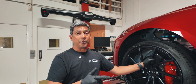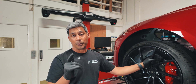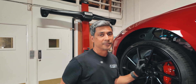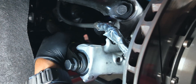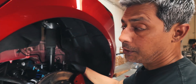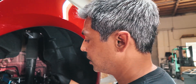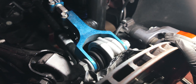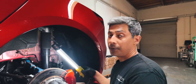Now we're going to pop the rear wheel off and show you guys what's going on with the toe arms back there. We already changed the camber arm, so we can't really show you that, but I'll pull it from the box. Right here in the knuckle — you see that bearing? This is the toe arm. This was not a bearing on the older platform, and I do not believe it is a bearing on the Long Range Highland or rear-wheel drive or any other trim of Highland — I believe those are rubber bushings. However, the camber arm location was a bearing on the older platform, and they kept that on the Highland Performance. But on the other trims of Highland — long range, rear-wheel drive — that's actually a rubber bushing now.